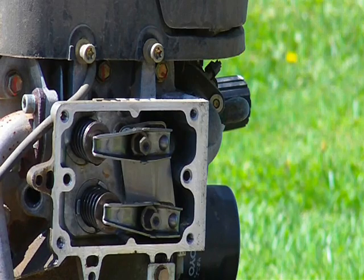The exhaust is right on 7 and the intake is about 5, but the 6 is a little bit tight going in, so it really doesn't even need adjusted. I run synthetic oil on this thing, and even mowing on a hot day yesterday it was comfortable — the air coming off the head just feels warm after running it for an hour. So I don't even know that it needs to be reset.